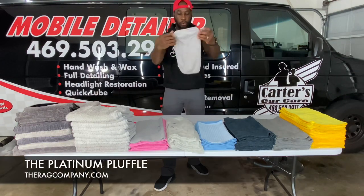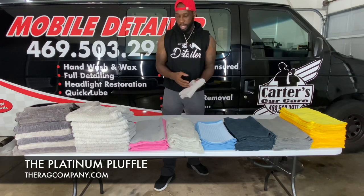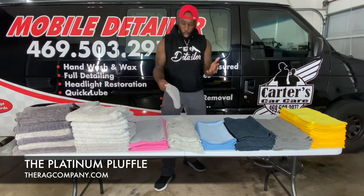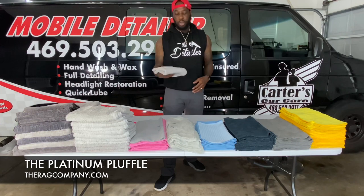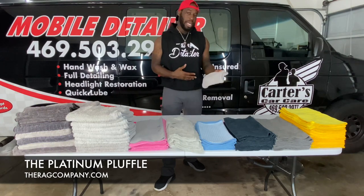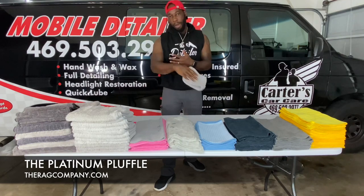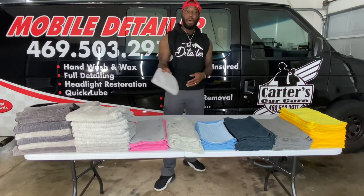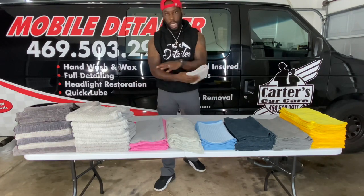It's perfect in the hand, you fold it up in fours. Come through with the final wipe down, the spray wax, spray sealant. Once you do your final wipe down, your final inspection, I use these towels. Or whenever I'm doing paint correction, laying down some wax or polishing, I use this to wipe it off, because I never know if the paint is going to be hard paint or soft paint. These are pretty safe to use on soft or hard paint. You don't want to come in with a hard towel to wipe off polish or compound or wax and start putting micro marring in the paint. A wrong towel is a no-go.